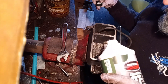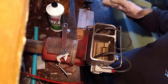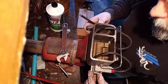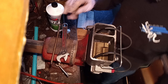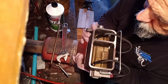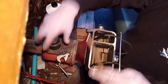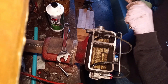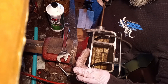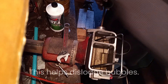Now let's go ahead and fill these reservoirs. I'm only going to fill them about halfway because once it sits in the car it's going to be at an angle and you'll be topping them anyway. Now, reading the shop manual, it says to tilt this forward a little bit. So I'm going to tilt it forward just a bit and then work this. I'll use this socket to protect my hand as I press the piston down in here.